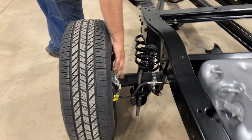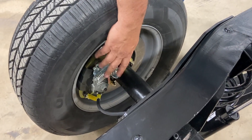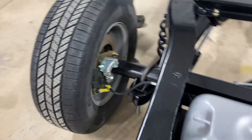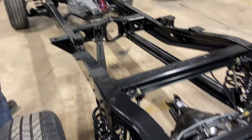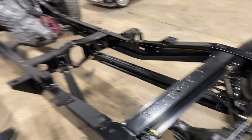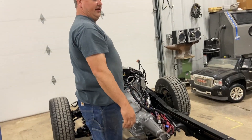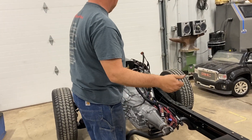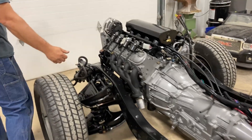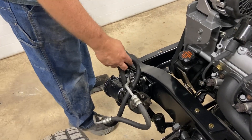A little upgrade on the truck: it's got Cadillac Eldorado brake calipers, so it's rear disc. Not everyone knows that, but those are Cadillac Eldorado calipers with an adapter to connect to the truck 12-bolt rear end — which is different from a GM car 12-bolt rear end. We have the driveshaft being made by our buddy Matt at Fleet Pride; he's supposed to call me this week when it's done and we'll go pick it up.